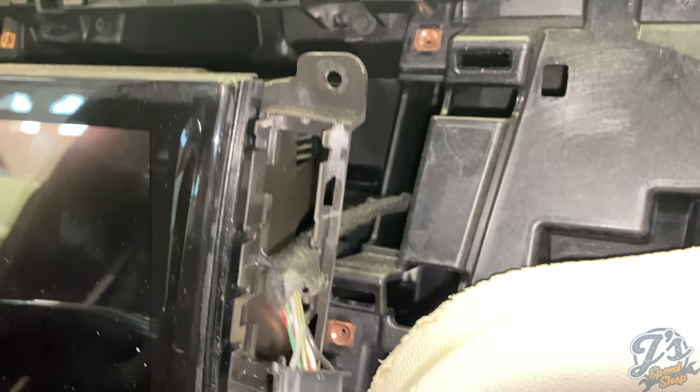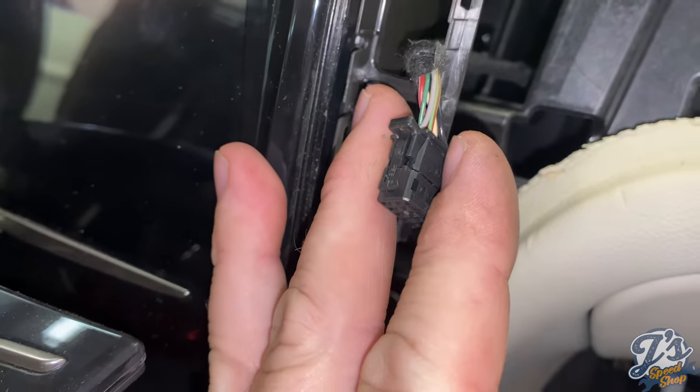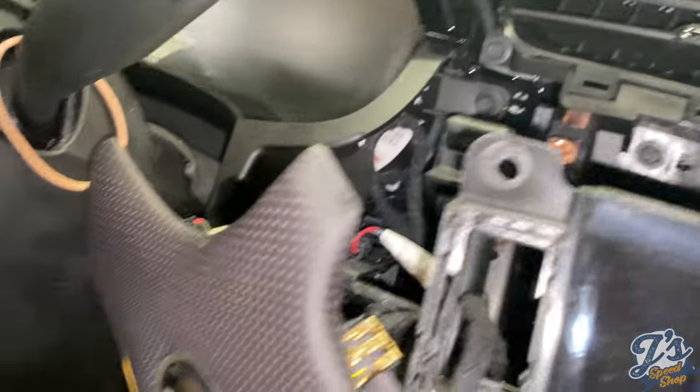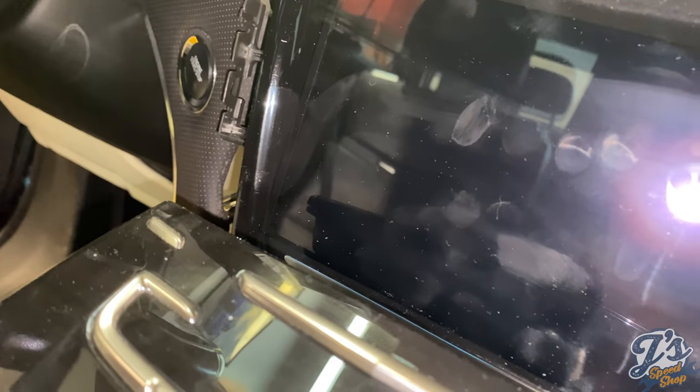One thing to watch, I thought about maybe leaving these switches on. The reason you have to take those switches off the wiring is that the wiring comes through this top hole on both sides. You can see the wire comes through. So when you put this back together, you have to fish those back through. That comes out and sits there. Take this one out and just sit it up there. And at this point, we've got the module loose.